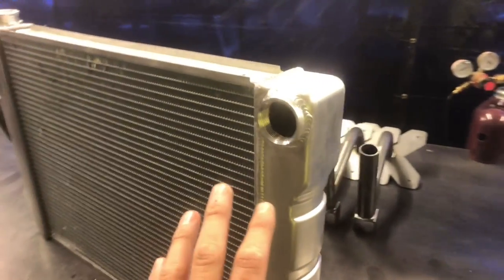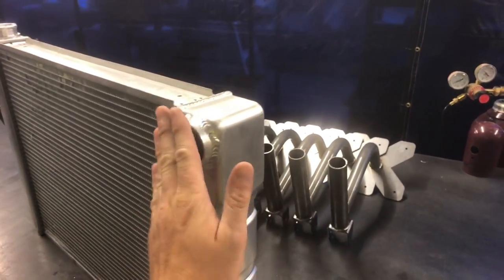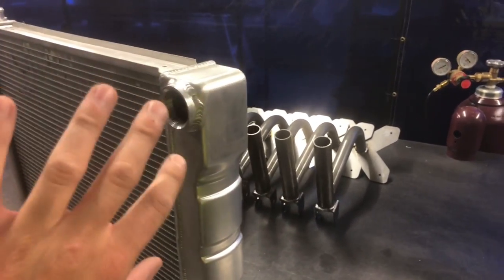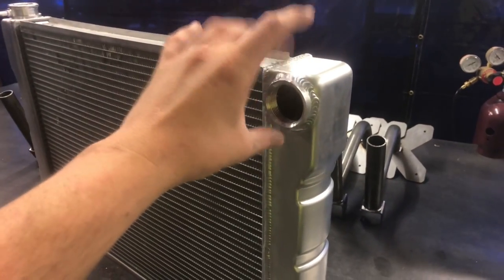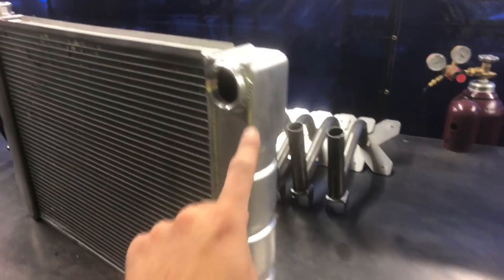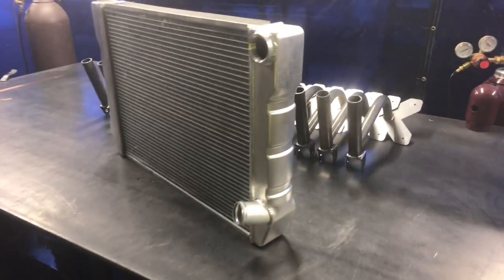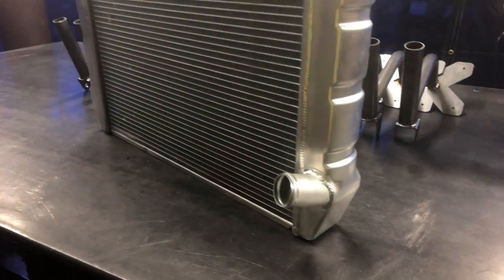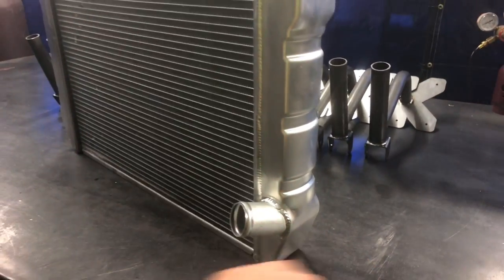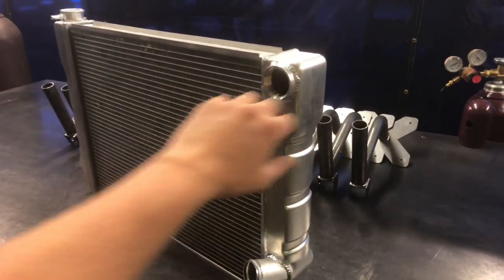While we're sitting here talking about fittings, the thing a lot of people don't realize is this fitting doesn't care where it's at on a radiator. So if having a fitting come out in the front doesn't work, weld it up, put a fitting here — some of the pumps have twin number 12 fittings, you can put it wherever you need. You're going to want the fitting at the top, but it doesn't matter what orientation on the end tank it is. You can buy blank radiators, but generally a lot of them come pre-populated with fittings. Don't feel obligated to use this fitting just because it's here.